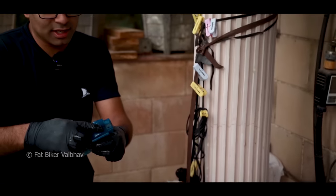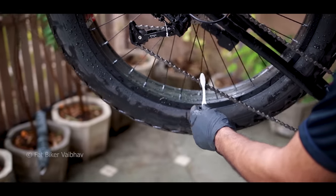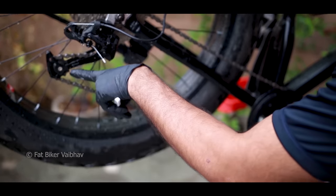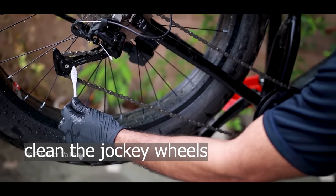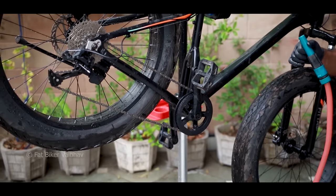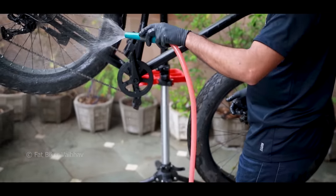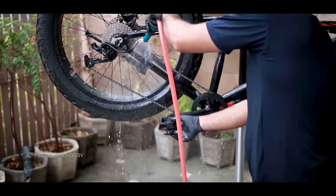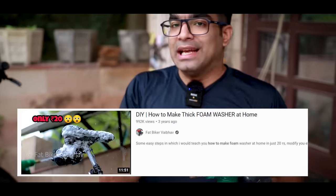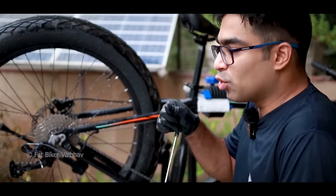It's a very clean way to clean the cycle. We'll use a toothbrush and clean the whole chain. There will be a lot of degreasing and the oil will be cleaned too. If you see the jockey wheel here, you have to clean it specially. For the clean-out, we take water and rinse our drivetrain. Some people ask whether to use a pressure washer — I would say don't use a pressure washer, use it normally in spray mode. Just back-pedal and the diesel will clean off. This is the foam wash I created recently. The diesel residue will also be removed.